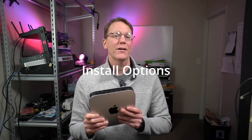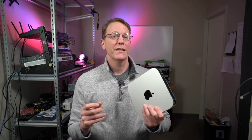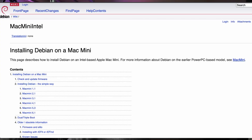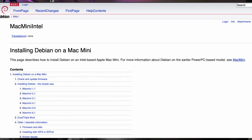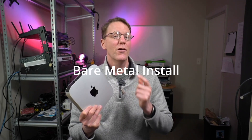You have four options. One is Parallels Desktop, where you buy it — I think it's $80 — and then install Linux that way. We're going to go over the no-cost ways. First there is dual booting, but I was not able to do that following the directions on the internet, which are a few years old, so I would not recommend that. Instead, we're going to install Open Media Vault directly onto the disk, or install Debian and then Open Media Vault over that.